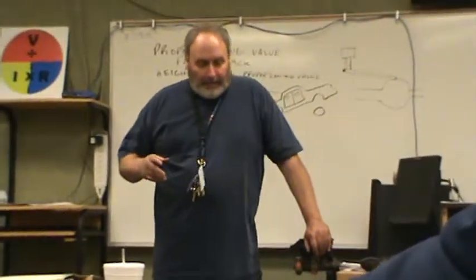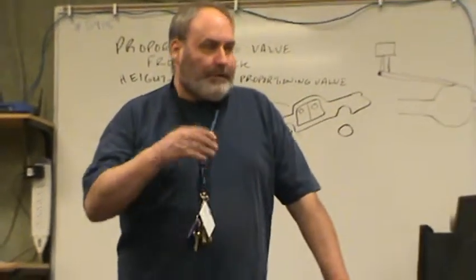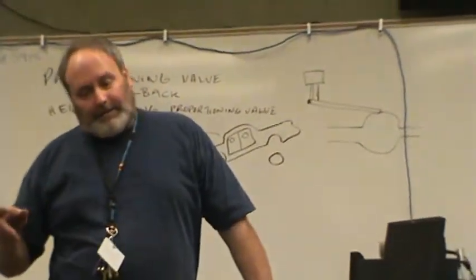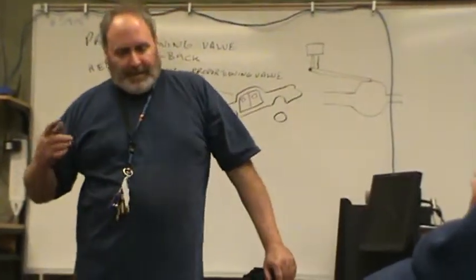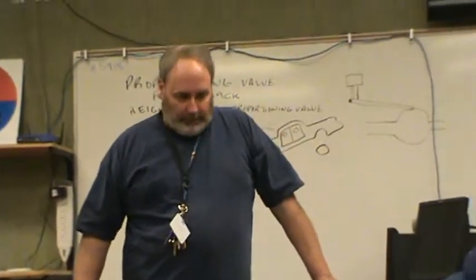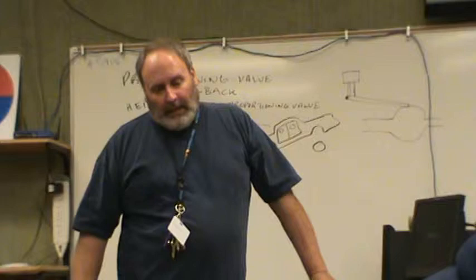Understand when we were looking at water in the brake lines, we saw that we're going to have dirty brake fluid because it's going to rust all the steel components in the brake system. That's one thing, but the other thing you need to understand is the sponge. Okay, look. Typically, when we see a spongy pedal is when we have what? Air in the brake lines. Good. Okay, but sometimes you can bleed the brakes, and you're not going to get rid of a spongy pedal.